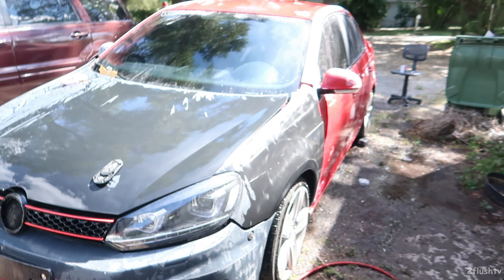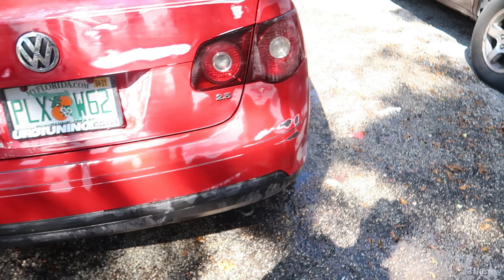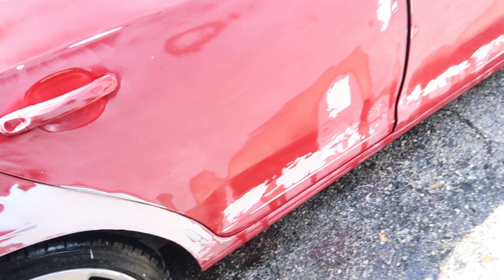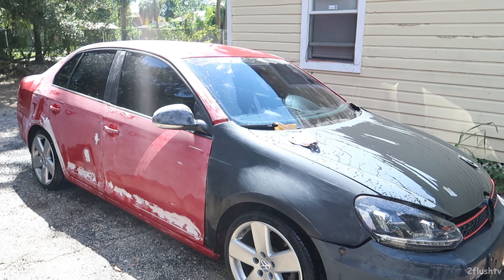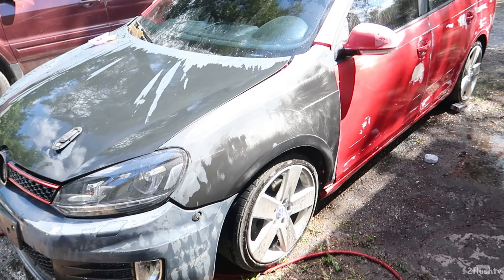I am done for the day — super tired. I got most of this car pretty much sanded down. I just need to take the lights out, get the new hood on, and get the tail lights out. For the most part the car is ready to go in for paint. They are going to sand it down more in the paint shop, but I've just seen so many cars go in and they haven't paid much attention to sanding or fixing body stuff. I wanted to take my time so that when it does go in, it comes back out looking pretty nice. Feel free to drop a comment and I'll catch you guys in the next video.